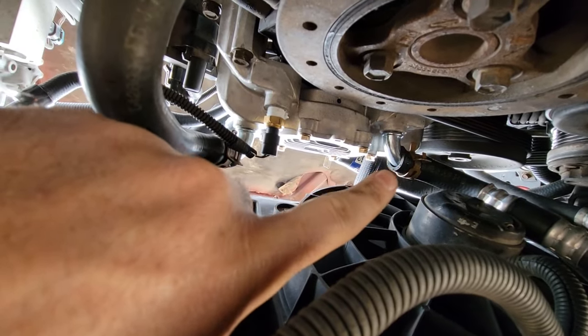You'll notice on the sides here it'll say which cylinder each wire goes to. You're going to want to label each of these just to make it a lot easier. You can ultimately follow them if you absolutely need to in order to get reconnected, but it's just better to label them so you can pop it on the new one without any issues. We're also going to need to remove this harmonic balancer wheel from the crank — just these three bolts — and then this will slide off so we get access to more of the OptiSpark.